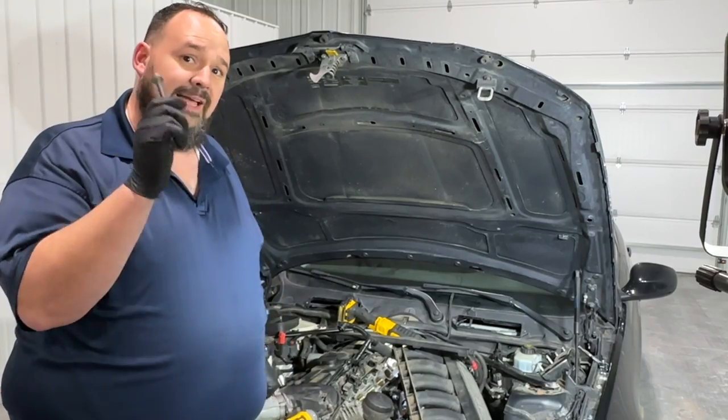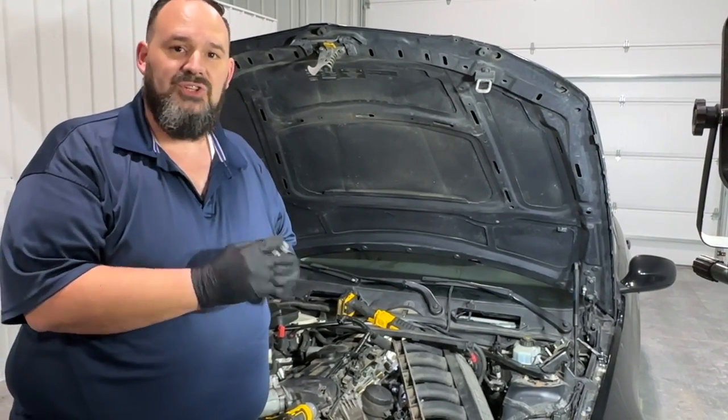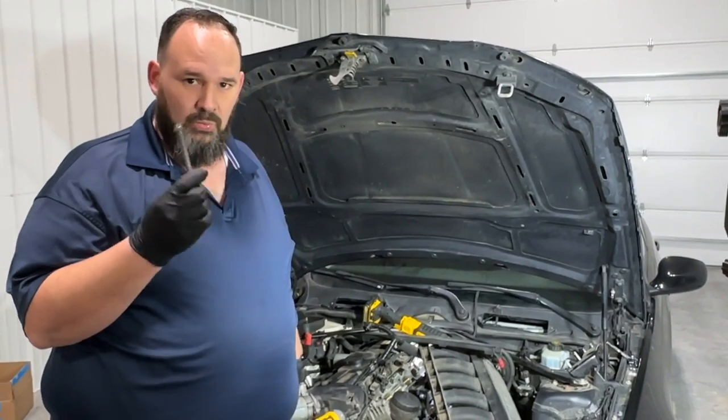I would recommend putting a little bit of penetrating fluid on it, because you can see the other end sticking out through the starter, so you can spray penetrating fluid on it, hit it with a little heat, and if you can get a slim wrench back there you might avoid everything I'm about to tell you. But once we'd rounded the threads, even with a slim wrench the socket would just slip and make it worse, so I knew I had to stop and figure this out.